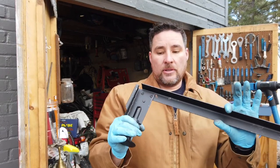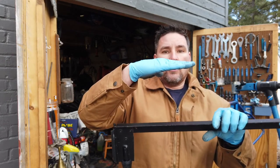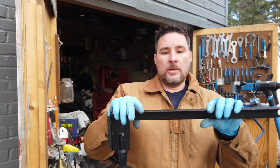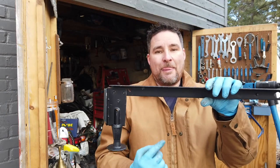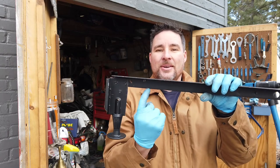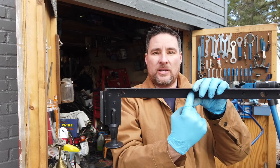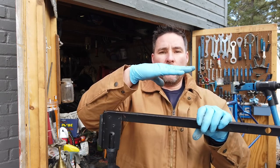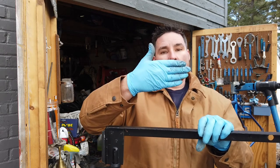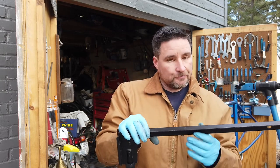I've got some bed frame steel here, and what I'm going to do is cut the pieces, one up and one down. Like I said, I'm not sure how long yet. I'm going to drill three holes: one that will go into the side of one fork, one to the other, and then one in the middle, and that will be our pivot. One up, one down, one on the front, one on the back. So there's going to be four of these all together.